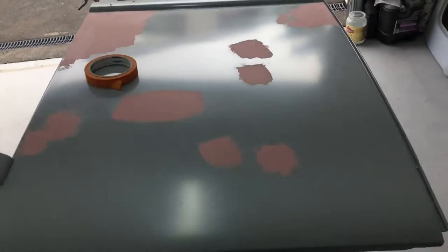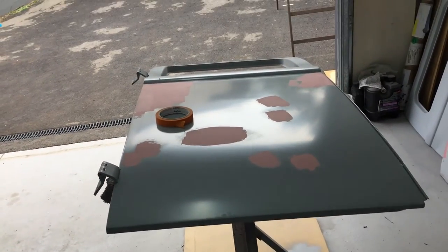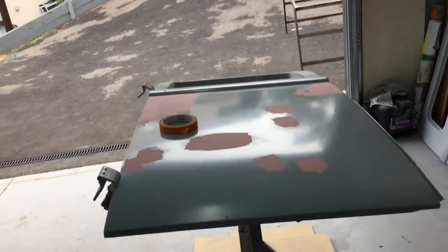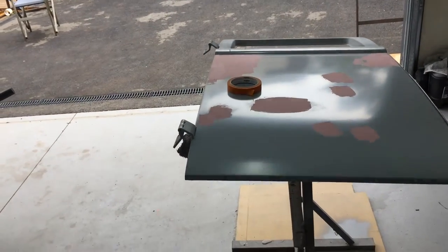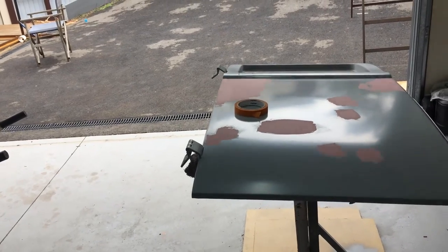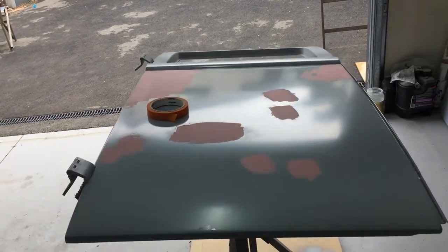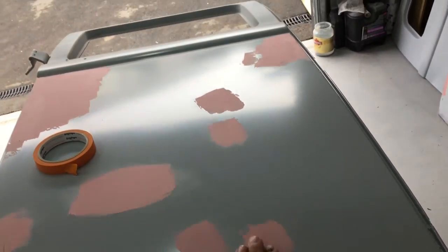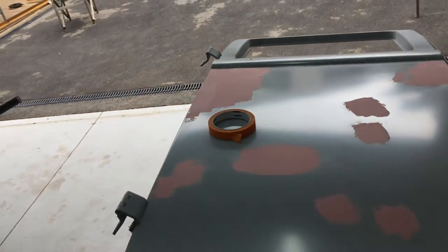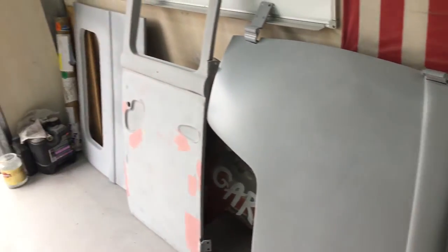I've still got a little bit of work to do on the cargo doors, well, pretty much all the doors actually. These ones, I've given them a coat of primer, but a thinned out coat so that it gives me a bit of a shine, and then I can come back and see where all my little imperfections are, because it kind of mimics what a final coat of paint would look like. So it's a good way. I mean, you can use guide coat and all that, but I reckon this is just a good way to do it. I'll rub that back, and I have had to go over all these little spots with that sort of putty. It's not bog, it's not a hardener one, it's just straight out of a tube and you just rub it on, but it gets rid of those fine little imperfections. So they all need to be rubbed back to get them ready.